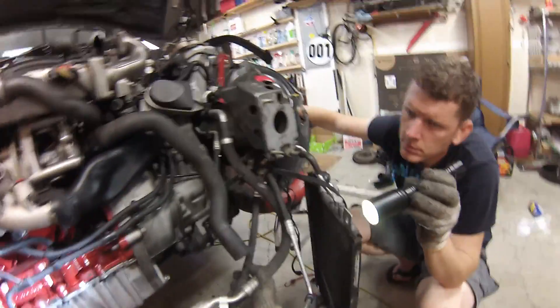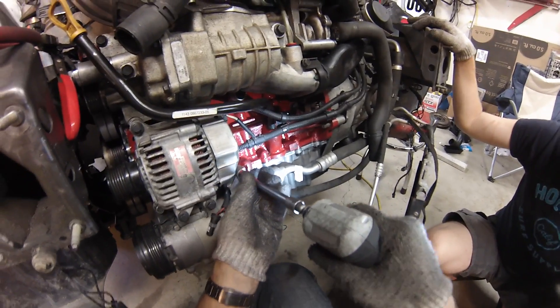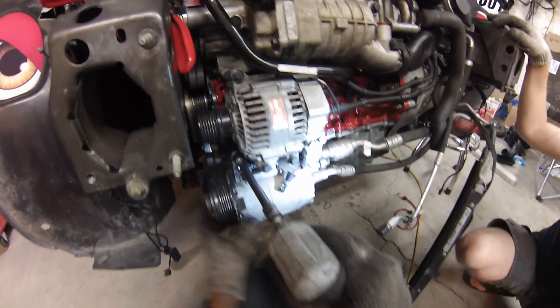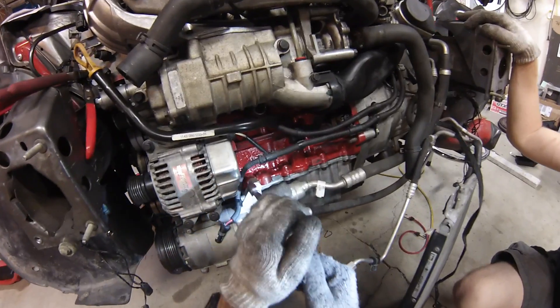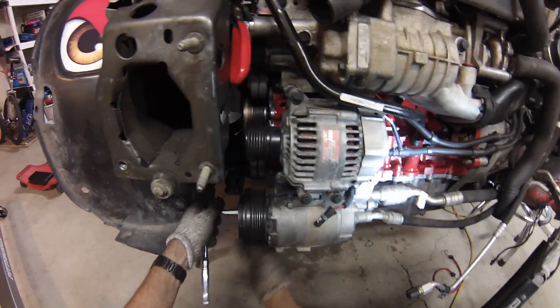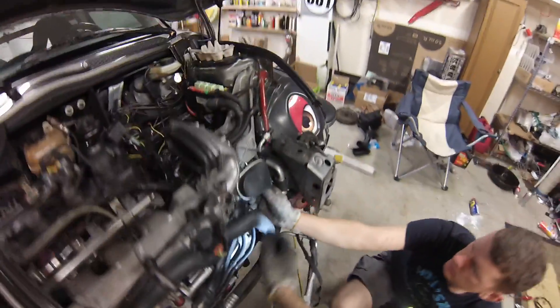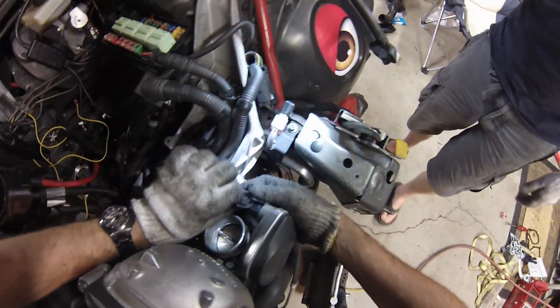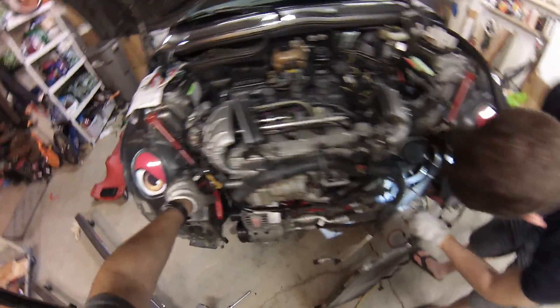Our air conditioning compressor — why doesn't it reach? Oh, there we go. We can put the belt back on. Put the locked component underneath the belt? Yep, nice and clean. That goes to the throttle body right here. Don't forget to plug this one in or the car won't start. Belt time — where's my belt? There it is.